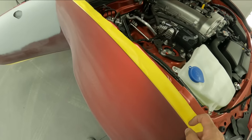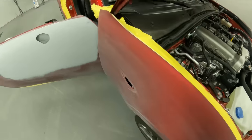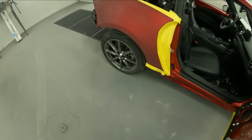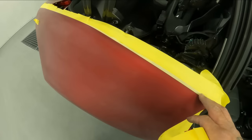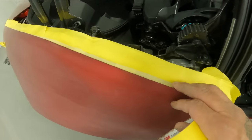That way the gap is open on this, because if you get into a bind and you end up having to put more material on, you can have problems with bridging on your actual tape because you're gonna have a lot more buildup on this. So you guys see we back taped it, but we tucked it down into the valley here.